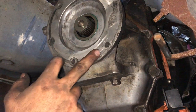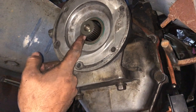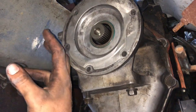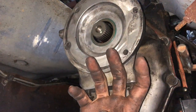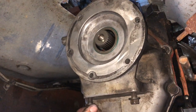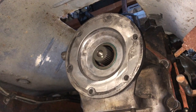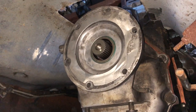I'm calling an audible on the transfer case. I wanted to use the DHD I've had laying around, but I know it's not going to work because the output on this manual is a lot heavier duty than on the automatic. I think I could change the input to the transfer case, but I'm just going to use a DLD I have laying around so I don't have to fiddle with it. This is going to be a work truck — not doing boosted launches — so more or less I'll put the DLD in and call it good.